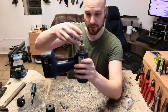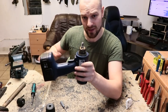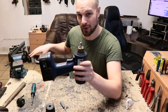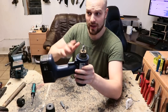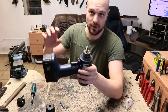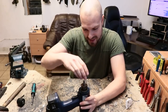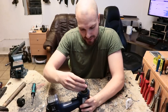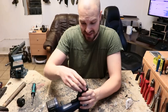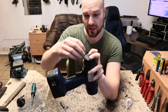Some improvisation is required — it took me two or three attempts to get it right. One thing that happened after my adjustment is that the numbers on the dial no longer exactly correspond to the original torque levels, which doesn't bother me much. I just know the lowest setting gives me enough torque without stripping bolts. You can of course take extra care reassembling it so all the numbers match, but my goal was simply to have that one lower-torque setting.